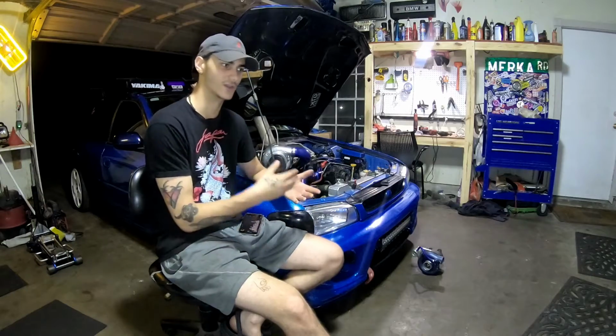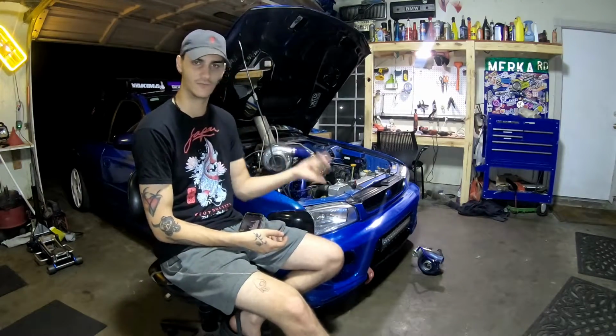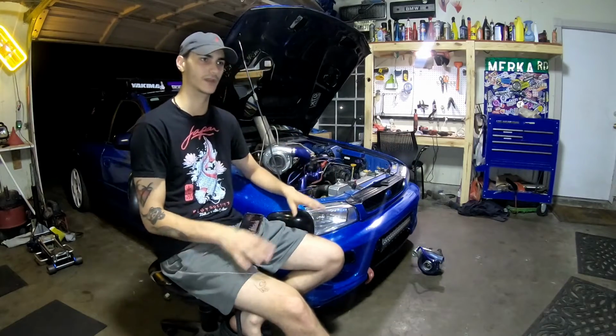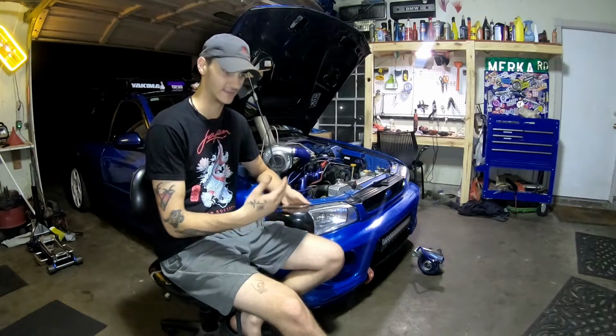So you'll be having way more fuel than you need, because I was going to put the injectors on before the tune, but he's like, no, that won't work at all. Everything will be messed up. You'll be running way too rich. So that's the thing you're going to have to worry about.